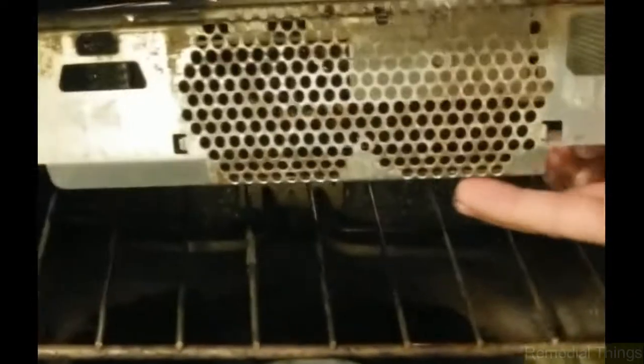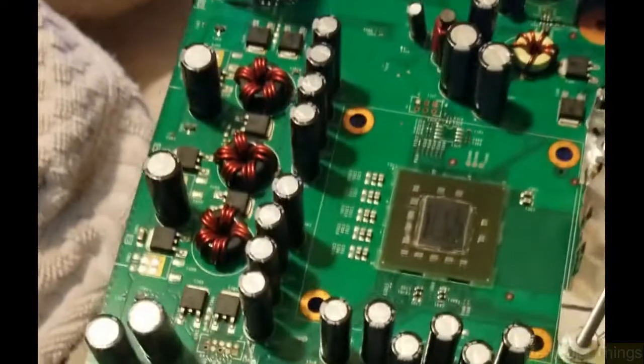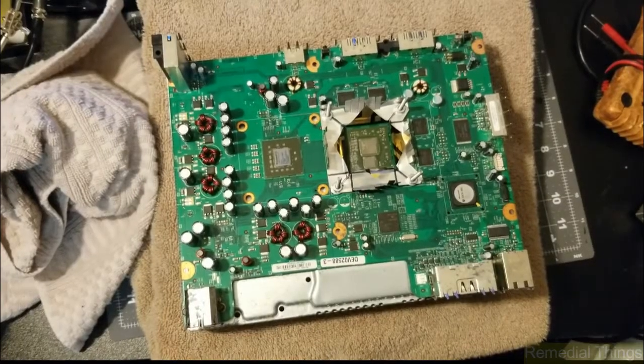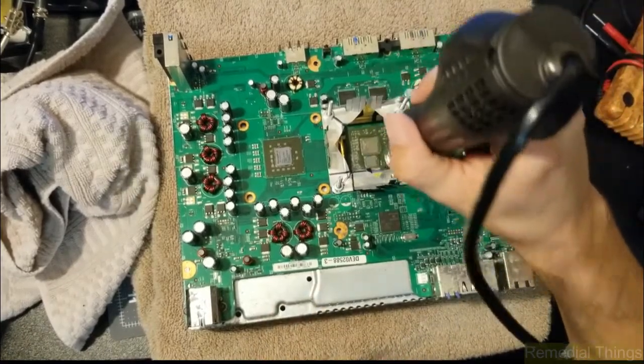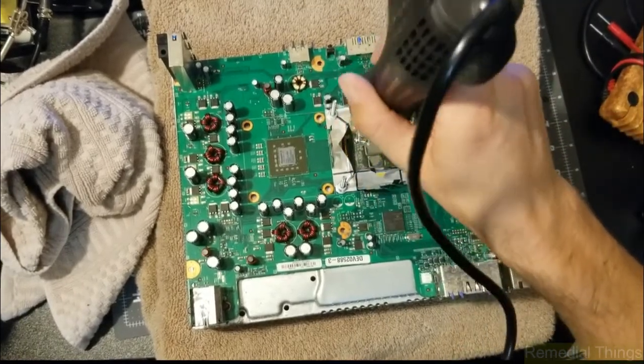The motherboard's nice and warm. I'm going to go in and grab our chassis — she's hot. Use a towel, grab the chassis and take it to our room. Set it straight on the case, as good as you can get it. We've got our heat gun set to 300 degrees, max air flow, everything nice and preheated. We're just going to keep hitting this GPU right in the shield. The longer the better from here on out.